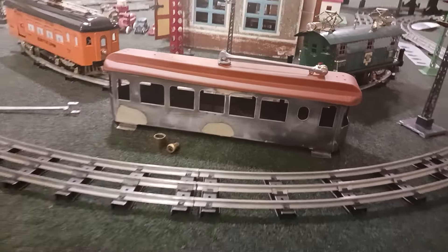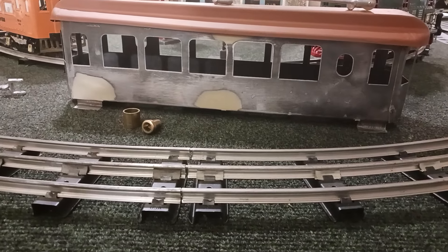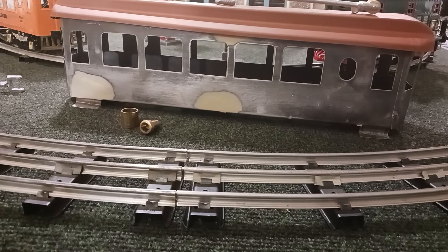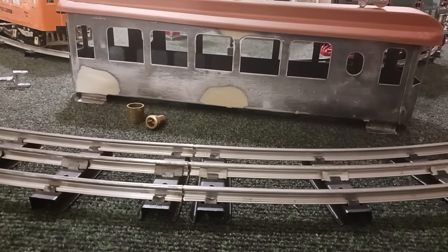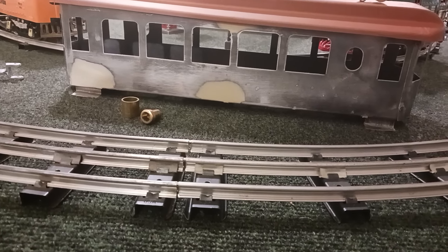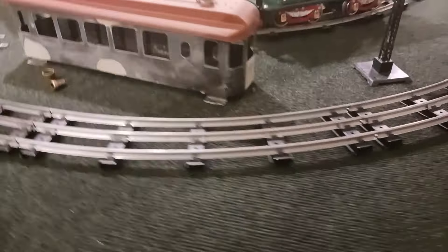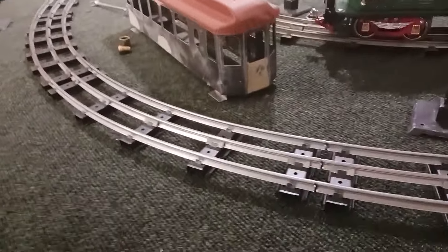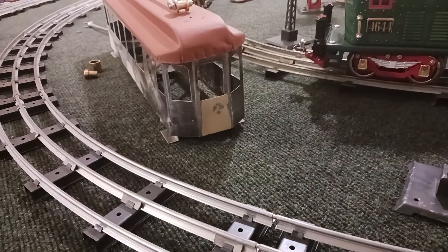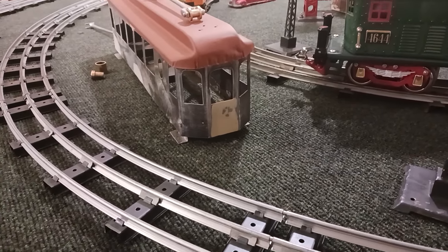I've done the bodywork I need to do here on the side. Those are just basically dings — that's where they're clipped together, but that was more than just the tabs being bent down. Somebody had put a little bit of force to it and stoved in just at the very bottom of the side. So I've got that all taken care of. We worked on the front a little bit, but this front was really bumpy. I had no idea what was done to that. You can see the high spot right there — it was like somebody had used a punch on the backside and peened it.